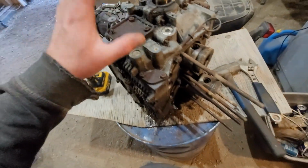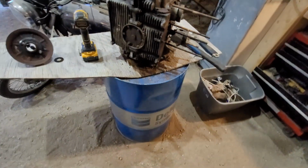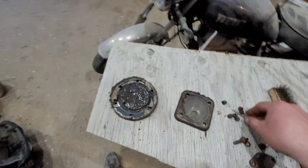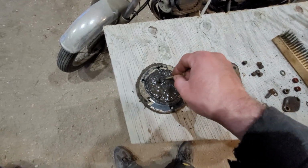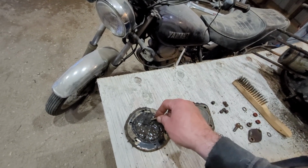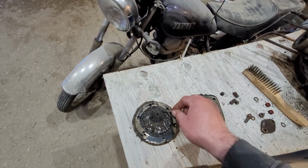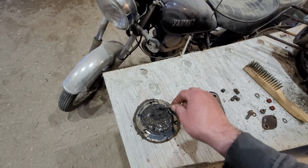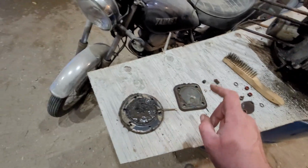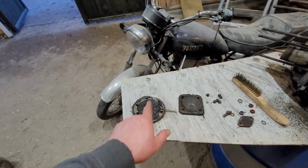And scared to know what the filter is going to look like, but that's why I brought it back to the dirty old barrel here, and we'll find out in a few minutes. Well, this don't look very good, so look at the slime. That is just over a 1/4 inch thick. Question is, is that magnetic? I'm definitely guessing that's magnetic. But you know, an air-cooled engine, no oil filter. It also has an oil bath air filter, I should say. That might not be that bad, but at the same time, I'm going to see if that's magnetic.